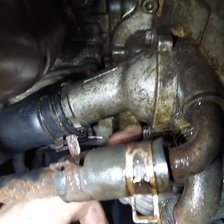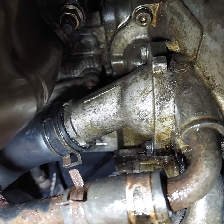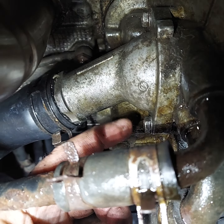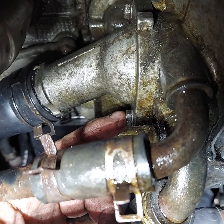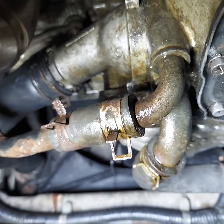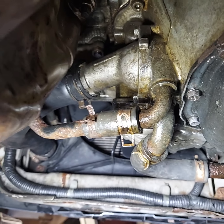These bolts — just tighten them up with German torque specs, which means good and tight. Remember they're not large bolts, they're just little jobbies, so bring them down until they snug up and then give them maybe another eighth to a quarter of a turn. Just use your head. Anyhow, we'll go up top and get the coolant level filled up.